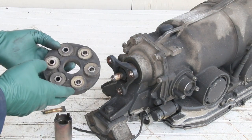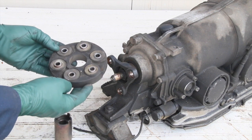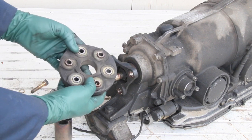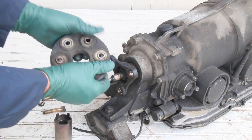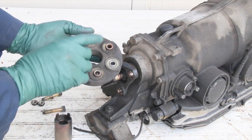First let me show you what I found with this rubber flex disc. It's a good example of why you can't just look under the car and say it looks okay, because from this side you don't see a lot of cracks. But when you flip it over you begin to see cracking here, here, and here, and these cracks show up as you spread the flex disc apart.